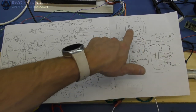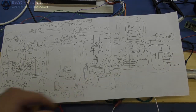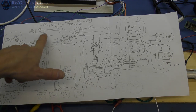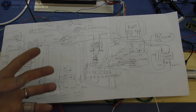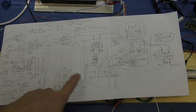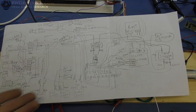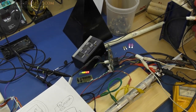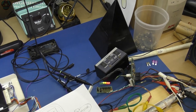On the high-voltage side, there's a plug that goes to a relay turning on the DC-DC CAN voltage converter power, with an external connector for that. Then you've got the motor controller with wires for key-on, throttle-one, and throttle-two. The motor, battery, and motor controller are connected up with a solenoid mounted on the front to turn the main power on and off. There's a flyback diode across the solenoid coil to prevent high-voltage spikes from damaging electronics. You also have the kill switch, fuse, and key switch all in series, coming back to a connector and then to the throttle. Everything truly happens in this black box controller — which I apparently broke.